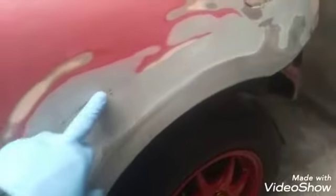As you have seen, the quarter panel is looking a lot better. Like I mentioned in the other clip, this was the first swipe that I did. A couple of old spots that I'm going to dress now. Got a little bondo filler — I don't like using regular bondo. I use bondo glass, which is a lot better. But for little things like that, which is no rust, just to fill in pinholes, definitely. All this bondo is looking immaculate. This side is about 90% done.